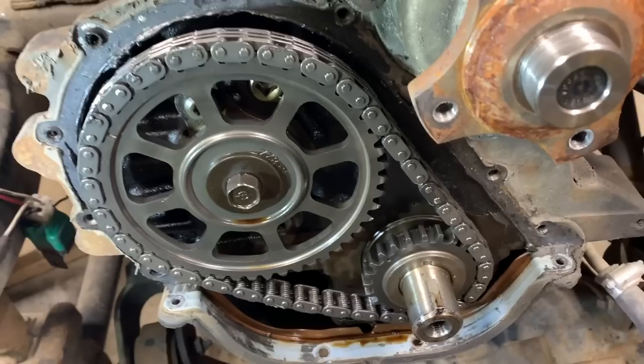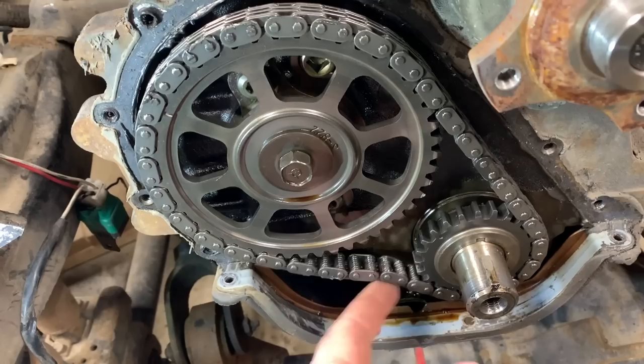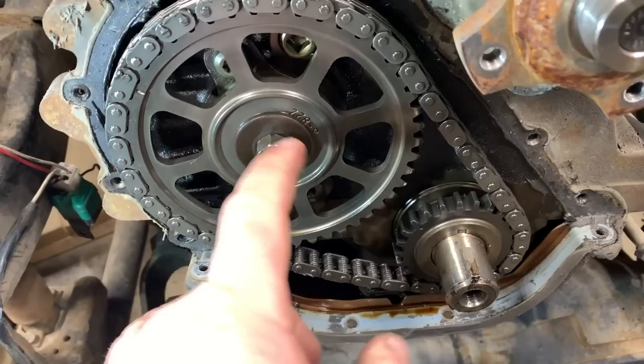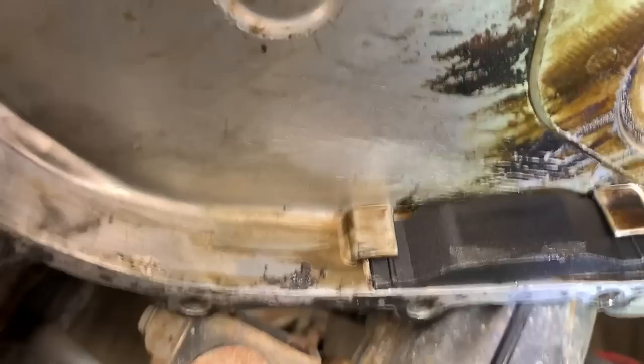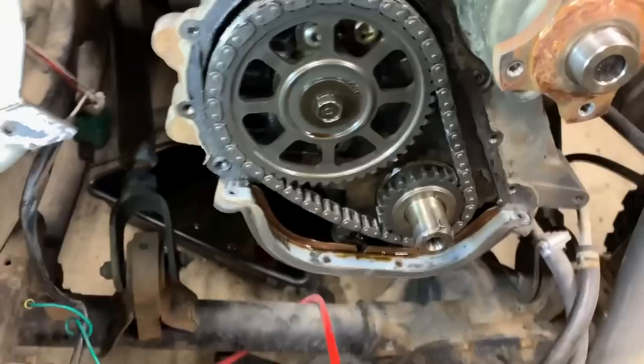A couple of things I want to point out here — I had this engine supercharged for a while and I put in a timing chain not that long ago, but there's already quite a bit of play in this timing chain. Before we can remove it, there's a mark right there and a mark right there that we need to line up. Also, have a look at the case — see how the chain has been rubbing on it? That's kind of like a tensioner or guide that helps keep the chain in place.